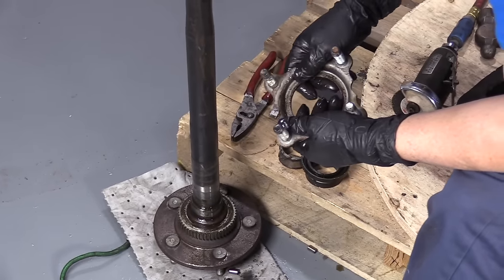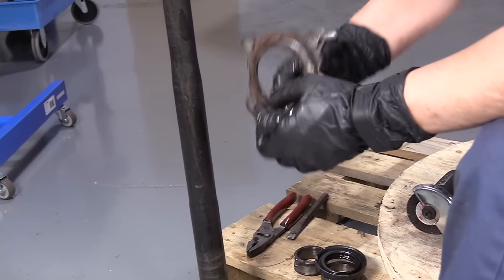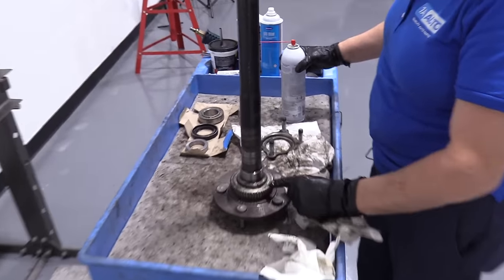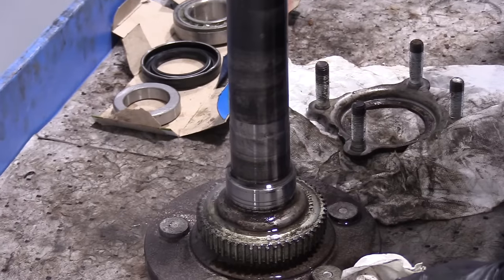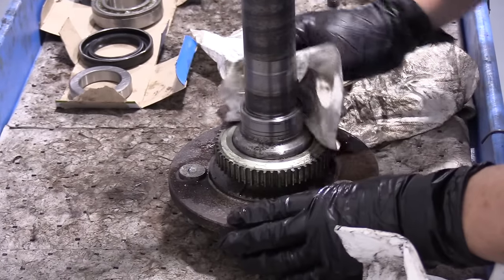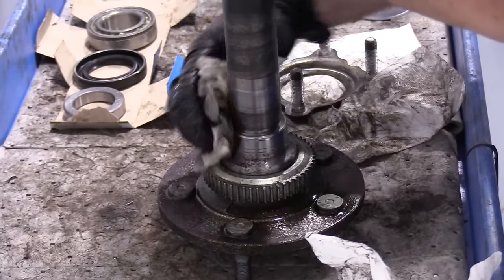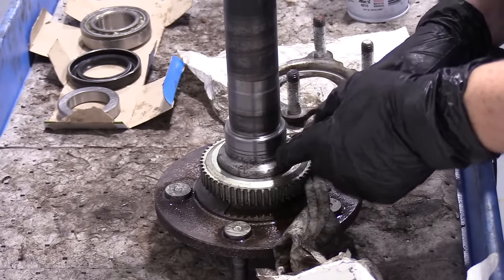You don't have to replace the retainer unless you press it and bend the steel or cut into it. I made a little notch, nothing too big. Now I'm going to clean up the axle area where the bearing sits and seal before I press the new one on. Just use a little parts cleaner, brake clean. Wipe it down with a rag. I'm checking for burrs also — make sure there's no burrs from the old bearing or anything that I might have caused. Sometimes you can't visually see everything, you have to feel it, and with the grease gone I'll be able to feel for any burrs. I don't feel any — that's cool.